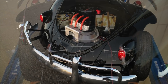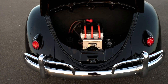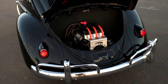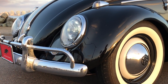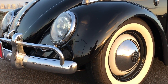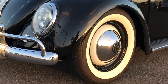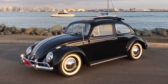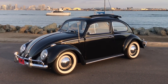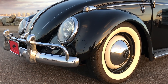This motor has a little more horsepower than before — it's about 100 now — and we also relocated some of the components back here for a cleaner look. We have some changes up front. We replaced the stock beam with an adjustable one. Now that the car is a couple hundred pounds lighter, thanks to the Tesla batteries, we can use this adjustable beam to dial in the correct ride height. I like it about one to one and a half inches lower than stock.